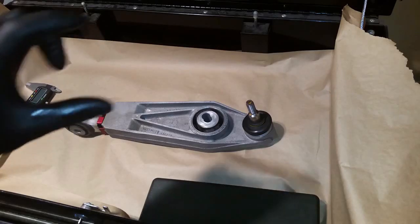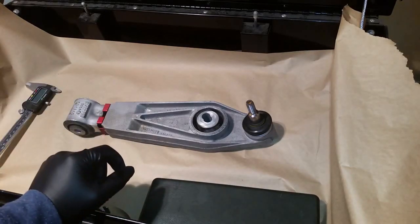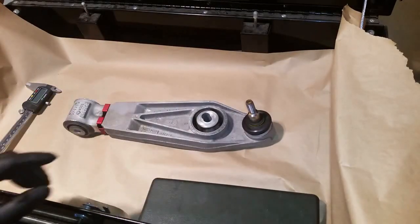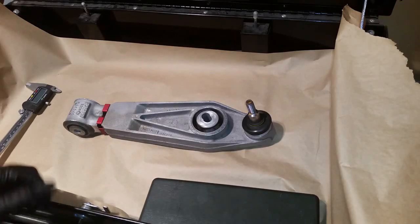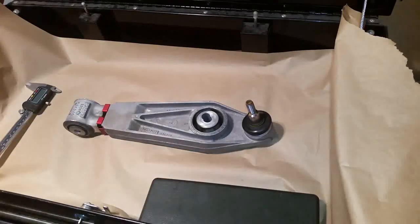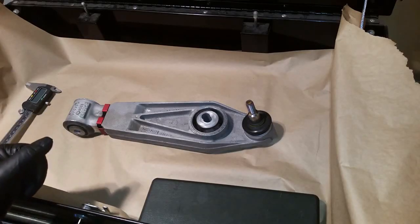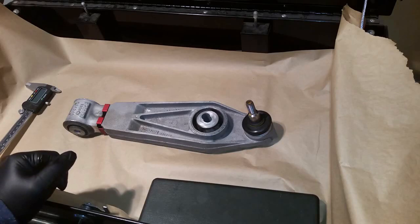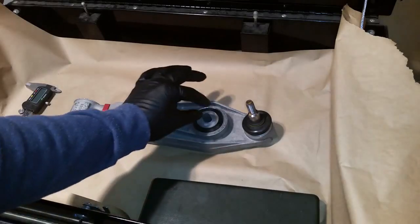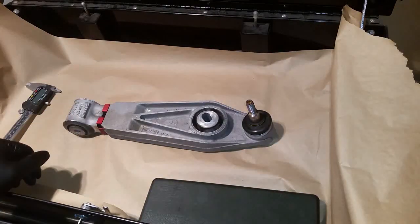What is different is the size of the opening of the thrust arm or trailing arm — that one is bigger on the Cayman. You need to either change this part, which I'm not sure is easy to do, or your other option is to buy a new thrust arm.